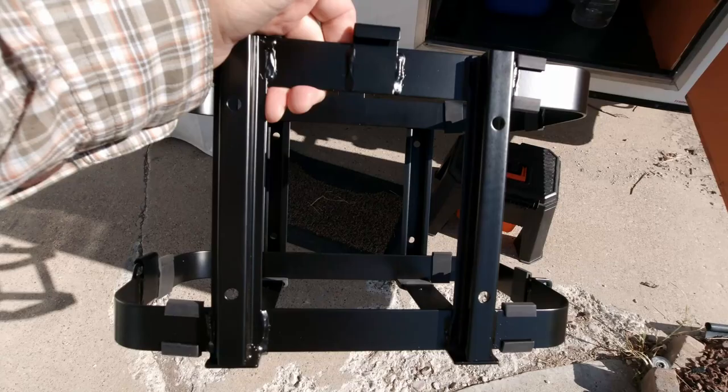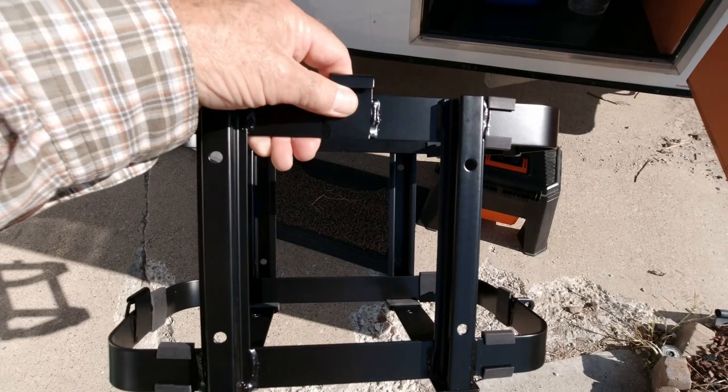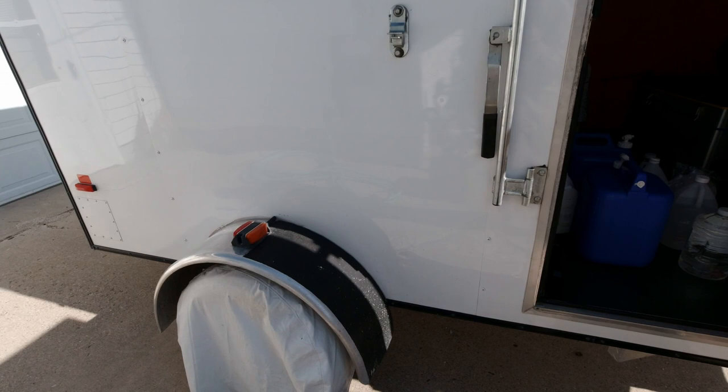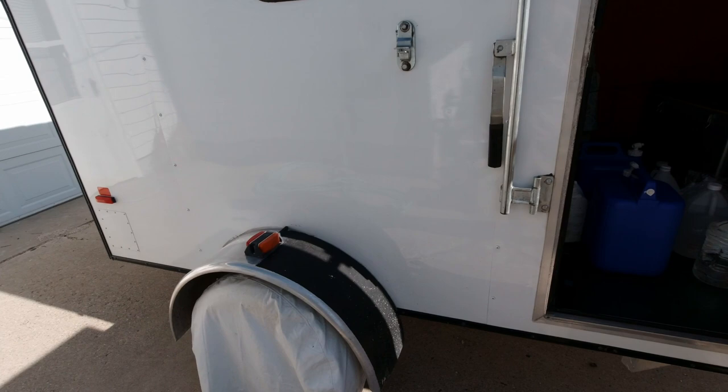These are handled by a company called Smittybilt — they're all welded. We'll see how the installation goes. I'm going to walk you through it because, as you know, the trailer walls are actually hollow: very thin aluminum on the outside, very thin sheeting on the inside. So I'll show you how I'm going to support these. When you go down a bumpy road, this trailer is rocking back and forth side to side, so I'm going to show you how I'm going to counteract that so it doesn't tear these mounts apart.